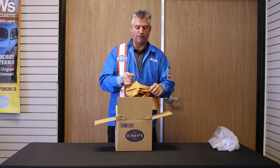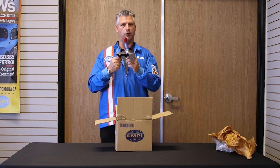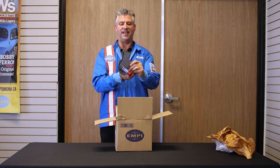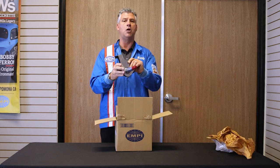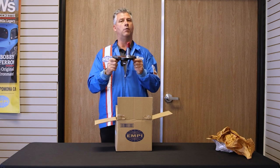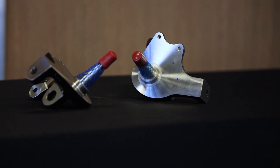What you're getting here is a pair of forged zero-set drop spindles, two and a half inch drop. So you lowcar people, you're going to be very, very happy. But take a look at these — the fit, the finish, the machining, really, really nice. This also can fit with our standard Wilwood disc brake kit, so this will fit right on there.